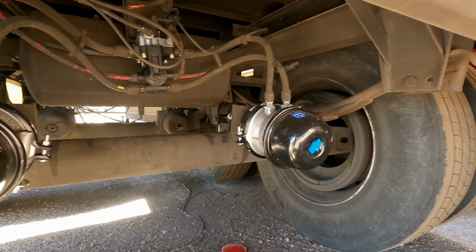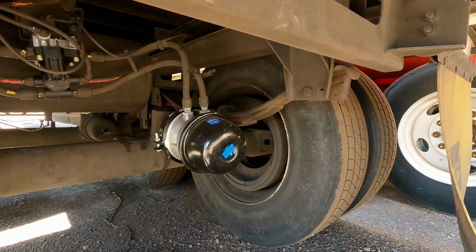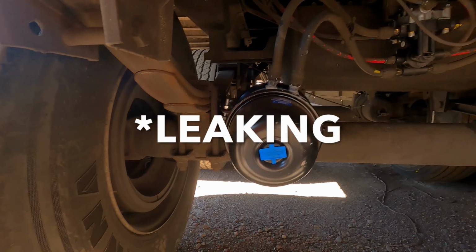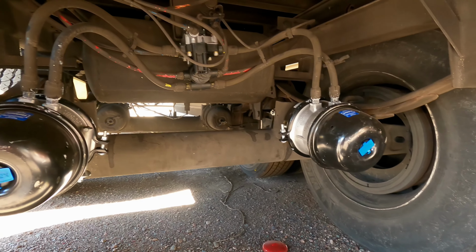Torque arms are secured, not damaged. The U-bolts are not broken or missing. The leaf springs are not shifted or cracked. The brake hoses are securely mounted, not cracked, worn, or leaking. The brake chamber is securely mounted and not leaking. The slack adjuster and push rod is securely mounted with a cotter pin, not bent, broken, or loose. No missing parts.